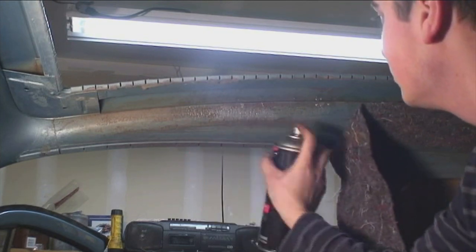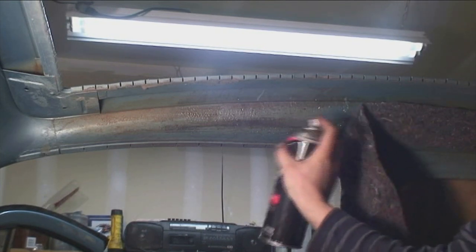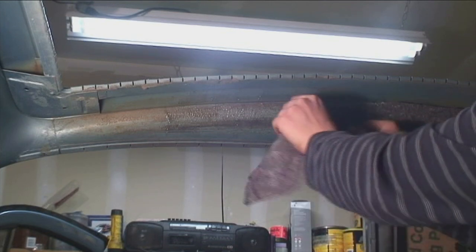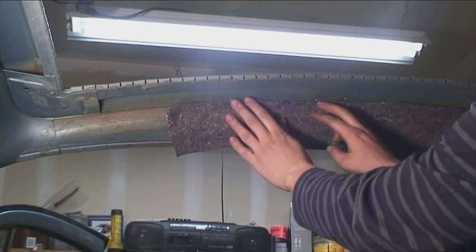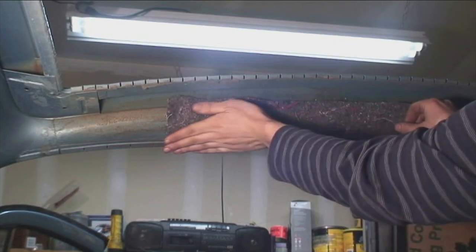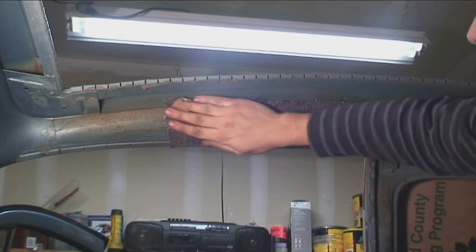This is the type of material where you have to take the plastic backing off the felt before applying. Now you start moving upward toward the front area. Make sure you get the correct glue spray — you want the one with the correct nozzle on the front. If you buy the general spray it's too misty and the glue gets everywhere. That 3M spray is more direct. Just cover a good portion of that pillar.